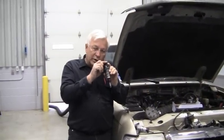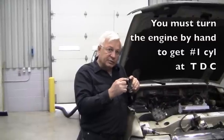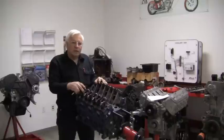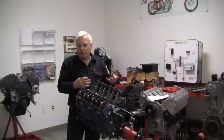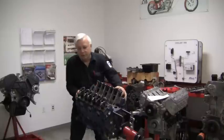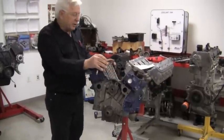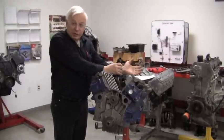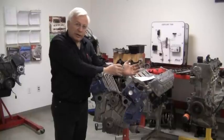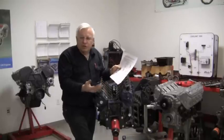Find the correct one and make sure it fits your synchronizer. You do have to crank your engine around by hand and get number one piston at top dead center so that you're ready to stab this. For this next part, I've come over to our engine room where we've got various engines because this part is hard to show you actually on the truck. But this is the same kind of engine. The front of the engine is out here and the firewall is back here — this cam synchronizer has to go back there. Sometimes the visualization helps you understand it.